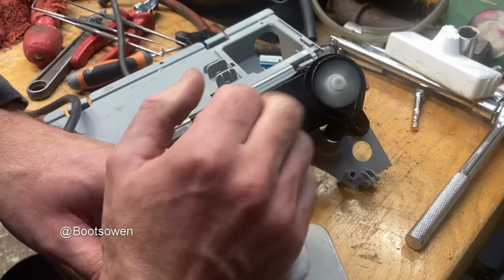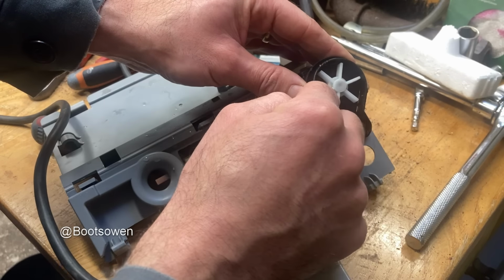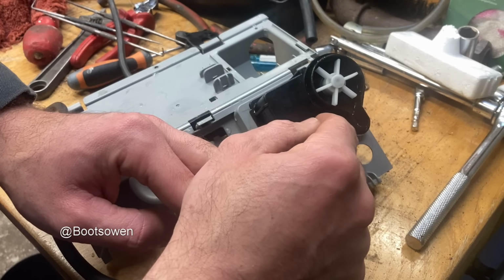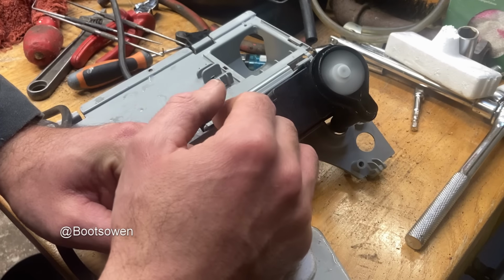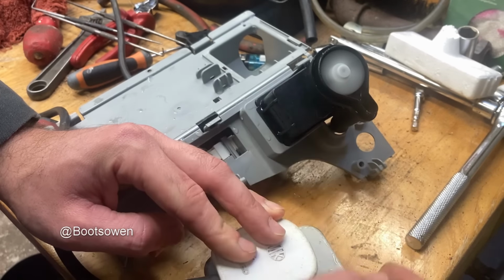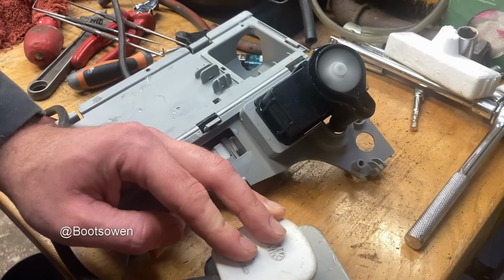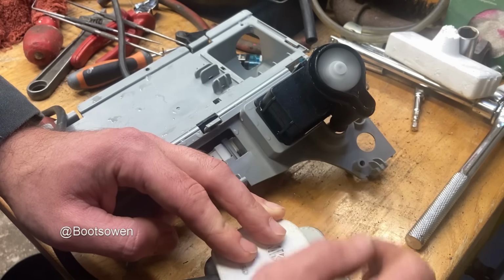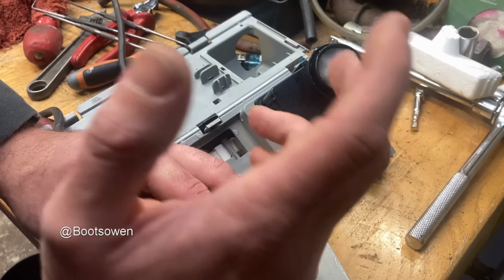So what happens then, I think, is that one of the bushings at either end of this is worn, and so when it starts off, because it's just got a field of magnetism around it and a magnet on a shaft, if the bushing's worn, it gets stuck to one side. I'd say that's what's happening. And once you kick it, it sets into position and starts off. So it might do it itself, but equally, that's all it needs. Yeah, I'd say it's an intermittent pump failure, all things being equal. So it might work some of the time, as we've seen outside, and it might not.